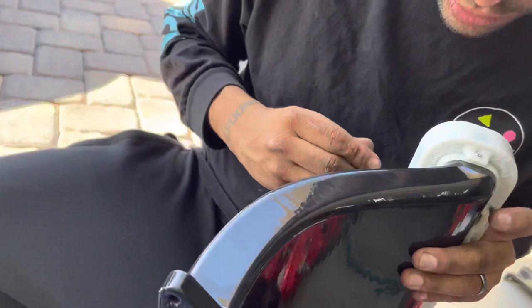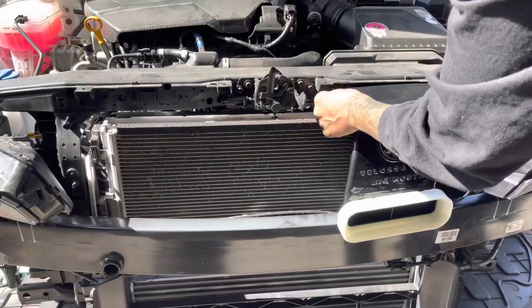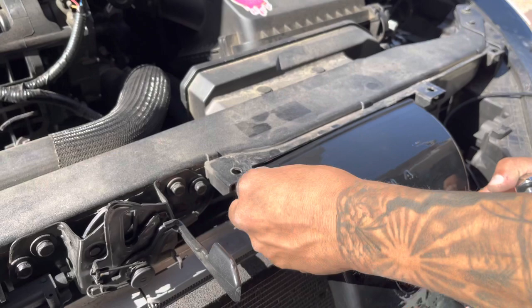What I'm going to do to mount this is take any two of the six bolts that I removed from that plastic shroud and insert them here. I'll always start off tightening something by hand to make sure it goes in straight so I don't strip it, and then I'll do the remainder with the socket.